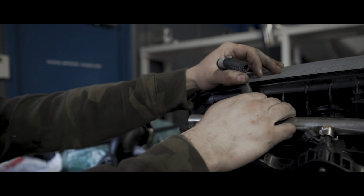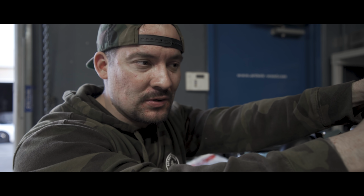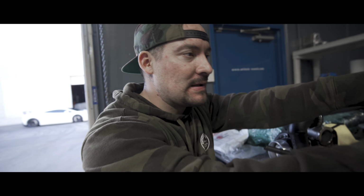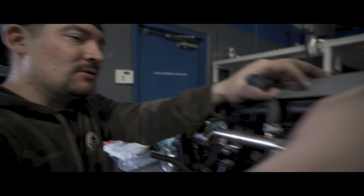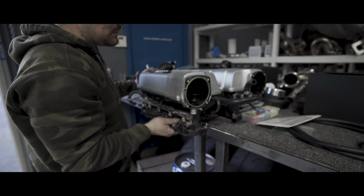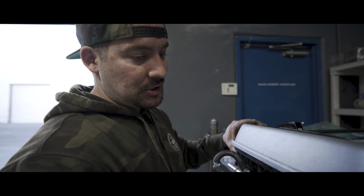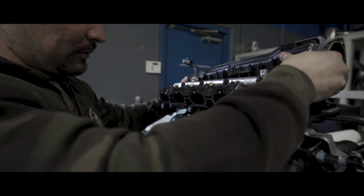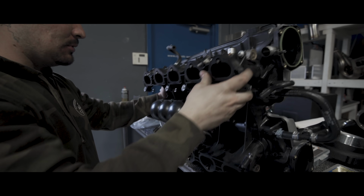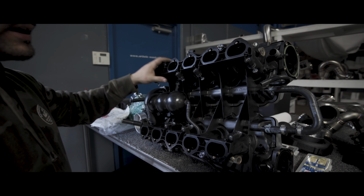So if you do our flex fuel stage 2 plus package, we're gonna keep your boost levels probably 12 to 13 pounds of boost for 1,000-1,050 wheel horsepower. When you get above 15-17 pounds of boost, I've been running into issues with these here and there. Some people don't have them, some people do. So that's why we're putting a billet one on my car, because I lean into my car, straight up. It's my personal car, I will push it and push it and push it until something breaks. It's the way you figure out things' breaking points, right?